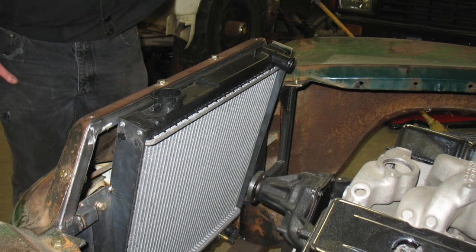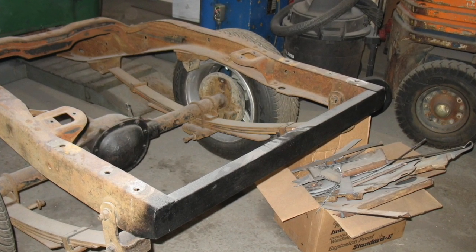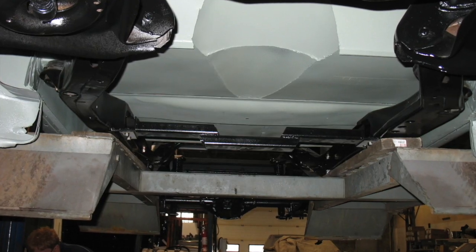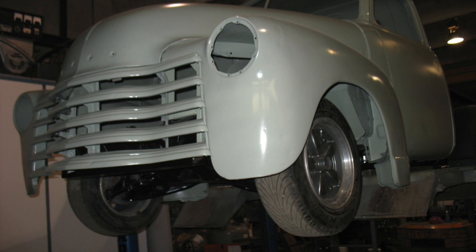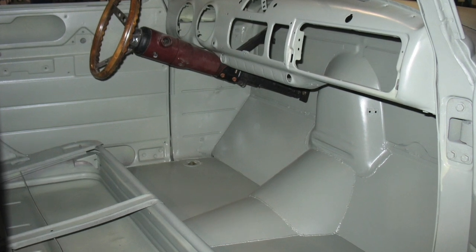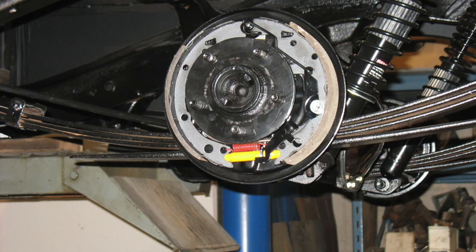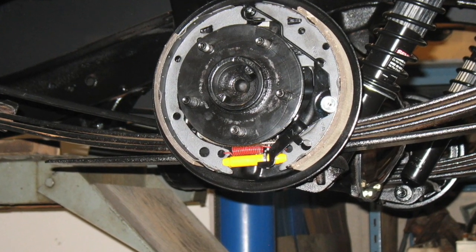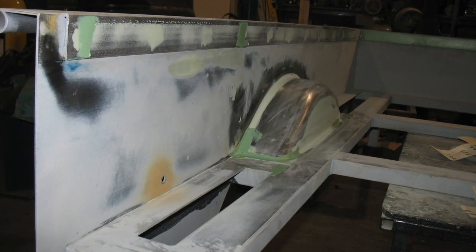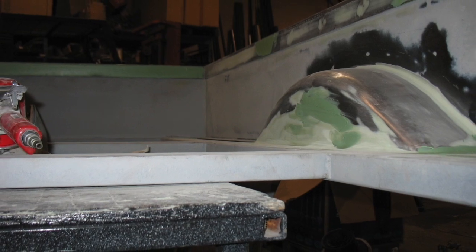The swap went over quite well. I used the original S10 mounts on the front of the cab, and I used the original 1951 Chevy truck rear mounts for the back of the cab. And the radiator that's in it is out of a 2006 Jeep, like the Rubicon, I want to say. It's the one that looks like their traditional Jeep. The way the rad hoses were situated and the mounting area was really a nice setup to fit in between the steering box and the frame horns.